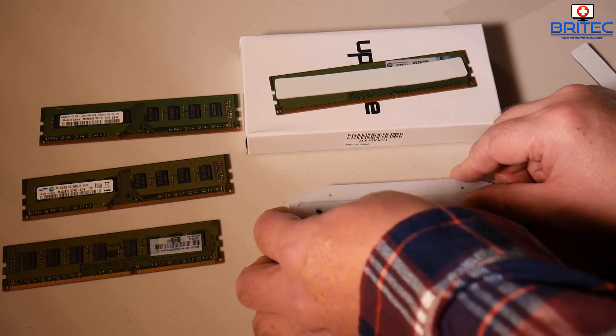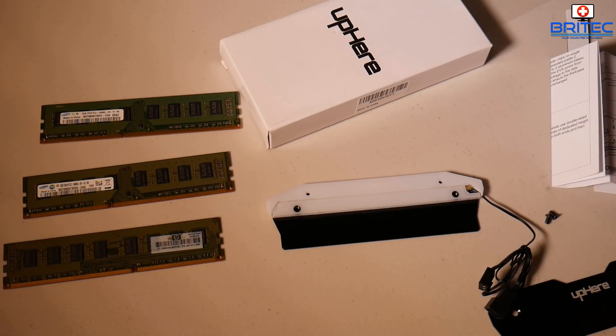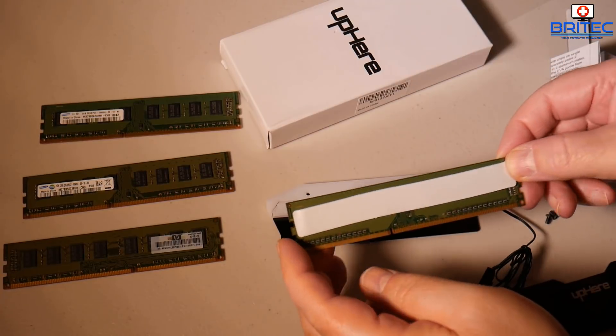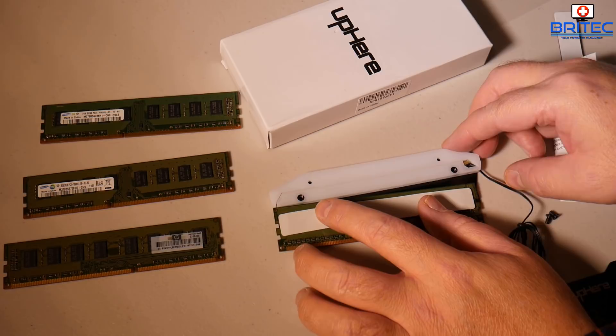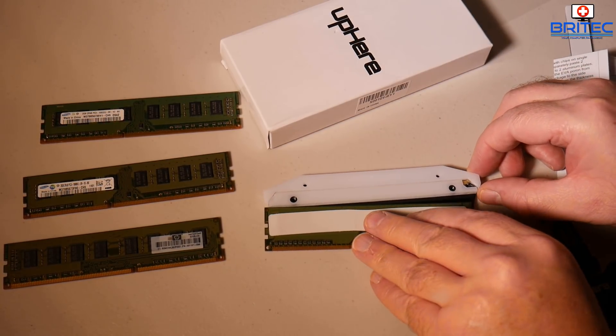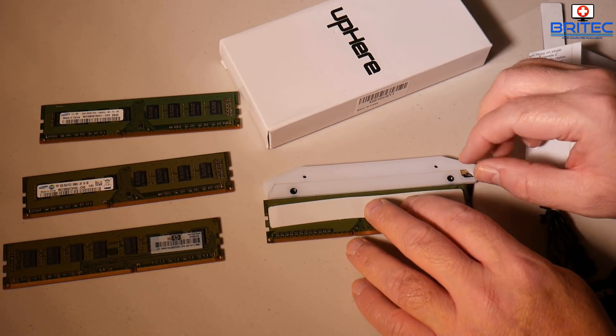The downside is you do have a cable at the back and this can be very messy, so make sure you get the RAM seated the right way. We want to make sure the cable is facing up the top so you can route the cable out the back of the case where it can't be seen.